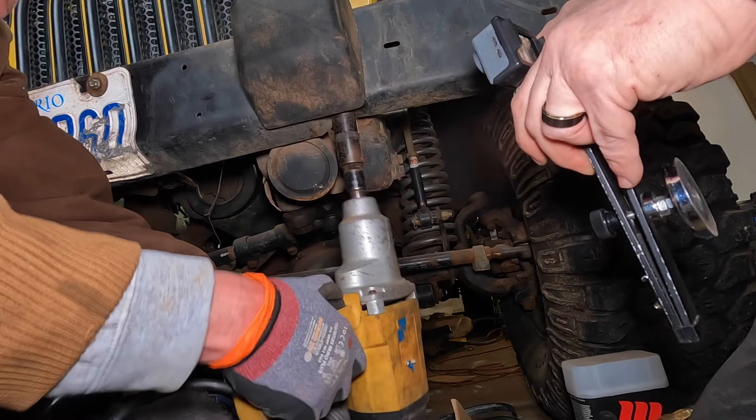This light I just removed — we're going to replace that bucket. The broken one I already tossed and here's the new one. I already removed the broken bucket; this one had a couple of tabs snapped off on it. The new one will go in — this one has 'left' marked on it, and this is the left side, so we're good. It does match up. We've got three little studs to just push it onto. Now I'm going to grab my headlight and mount her in there.